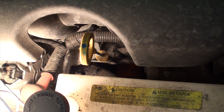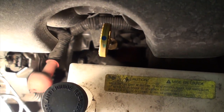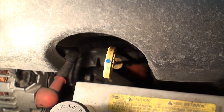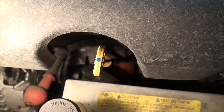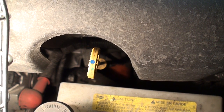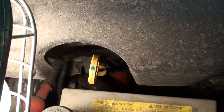The engine oil filter is actually situated right in the center of the engine, at the bottom of the dipstick. You can see the engine oil dipstick here, and at the very bottom there's a little orange cylinder — that is the engine oil filter. We're going to remove it from the bottom. I don't have a lot of clearance from under the vehicle, but basically you reach in from the cavity underneath the front radiator support and, using an oil filter wrench, remove the oil filter.